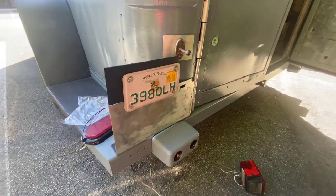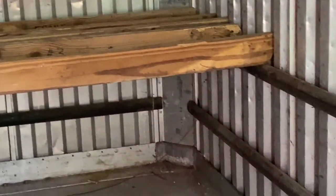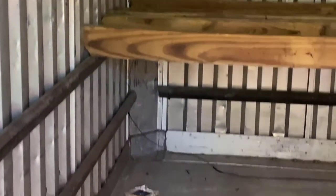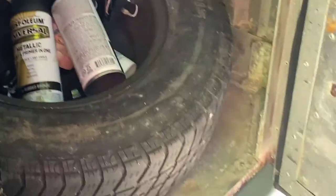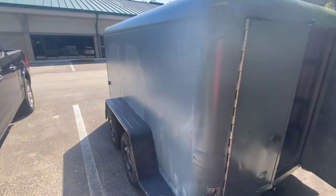I've got some new stainless hardware which I will be using everywhere. On the inside, I cleaned up this mess and ran some wires through the single positive lead. I'm going to use some flashing tape, run those straight up with wire loom, connect them together there, and back down at the parking light wire which runs through the bottom of the trailer. I'll clean up all that stuff down there using wire loom, zip it all up, make it nice and neat — waterproof it, tape it so it doesn't drag on the ground like it currently does.